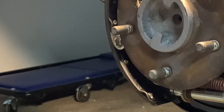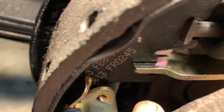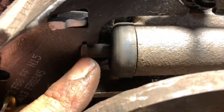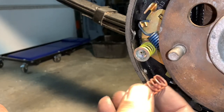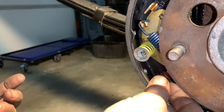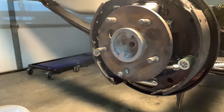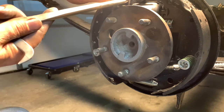Looking all up close in here — this is tied down, and there's a spring that goes in here. You can see it moves pretty easy. Our parking brake rod straddles the shoe nicely, and the parking brake lever in the back is being held in place. The shoe extensions go into the wheel cylinder — those are the points you put a little bit of grease on. Next we're going to put the springs in — the two other springs to hold everything together. The first one is pretty self-explanatory. Now for this rod — it hooks on here and goes up to the top, but this little doohickey has to go on there first. This is why I finally get to use the special tool — it sure makes this a whole lot easier. You could use side cuts or a screwdriver, but watch this.